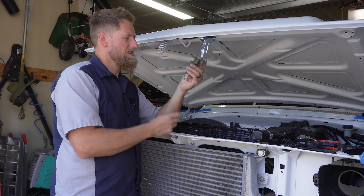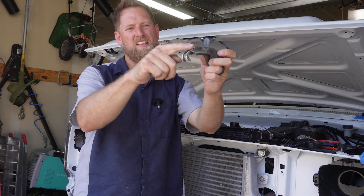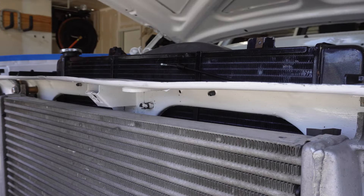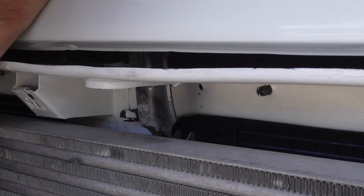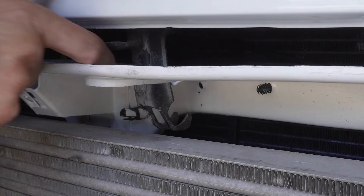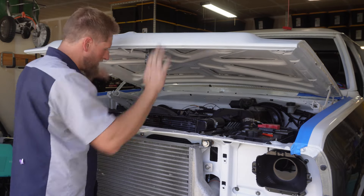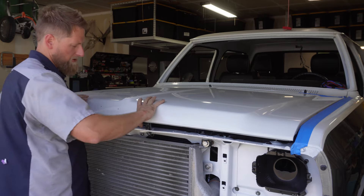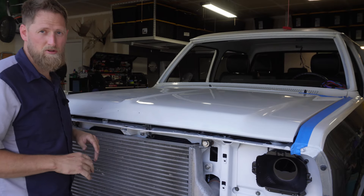Here's another hood latch I had laying around that I made. What I did was notch the latch out — it's not connected yet, but I'm going to weld a piece through here to make sure it's nice and secure. Let me throw this on there and show you how it clears much better. When I compress the hood all the way down we get no contact with the intercooler — that little notch is just perfect. The one thing with doing this when you're running the 7.3 intercooler is you can't just grab the hood and slam it down, because the latch will sneak past this part but won't clip underneath and could puncture your intercooler. So you just bring it down, get it to there, and then give it a little shove.